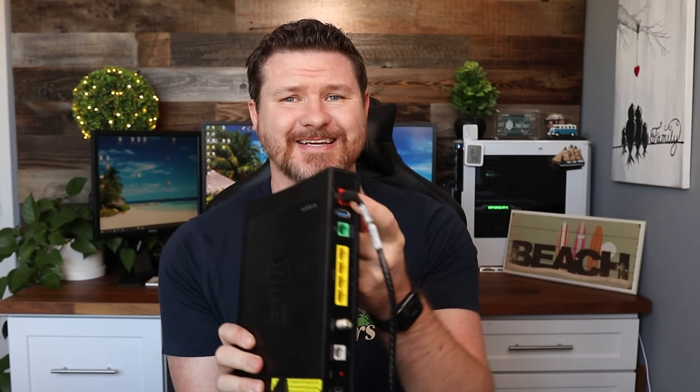Here is the cable modem with raw, unprotected internet coming straight in, shooting out of these ports. What do we want to do next? We want to protect ourselves. What we're going to want to do is get a router. A router is a device that is going to not only protect you with a firewall built inside — which is going to protect you from being completely exposed on the internet — but it is also going to have something inside of it called a DHCP server, which is going to hand out IP addresses to all your devices. Whether you plug something into that router or you connect wirelessly, that thing is going to automatically set everything up for you.